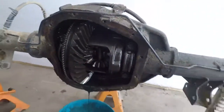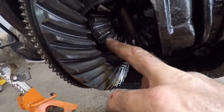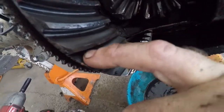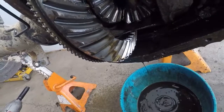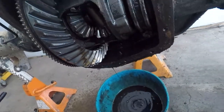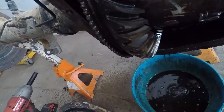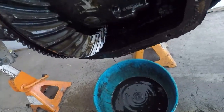We can do a little bit of rinsing and cleaning and see what we've got. Now, first glance after a quick rinse, you can see some roughness on the spiders — but not terrible. The running surface of the gears doesn't look too bad at least at this moment. Okay, we've got some pitting down there. Yeah, we've got some pitting, but it's mainly because of water.